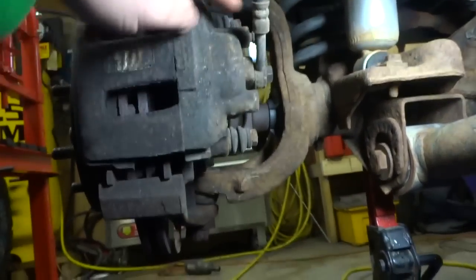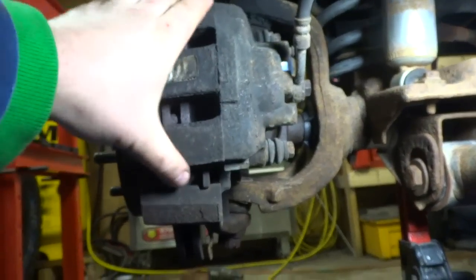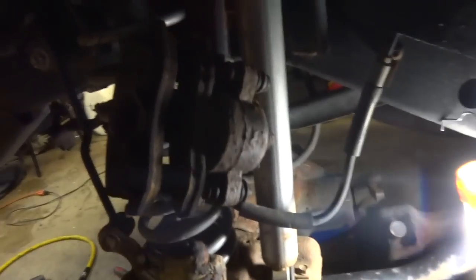So we're going to pull that out and see how well it works. Let's bust these brake calipers off by removing these two bolts right there and right there, and then the brake caliper will just come off. I got the caliper all tied up with the mechanics wire.